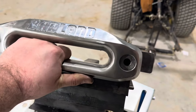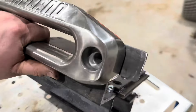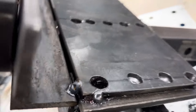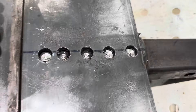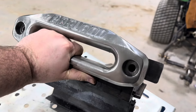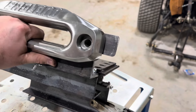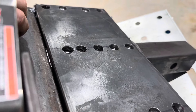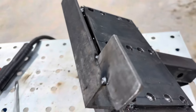We've got the little tabs on — I'll leave them like that. Never hurts to have somewhere to grab it, and you never know when you'll have a future use. This is how she's going to look. We'll be able to burn her in no problem. I've got this drilled — two there, two there, and five there for the plug welds. We'll burn it in here, connect everything together, burn in down here, and we'll be all set. I think this is shaping up pretty nicely. We'll start with the tabs, then work the heat around — maybe do the plug welds first, let those cool off a little bit, then burn the sides in.